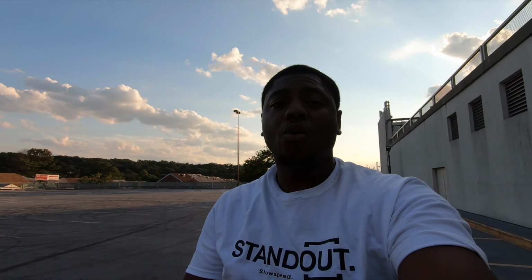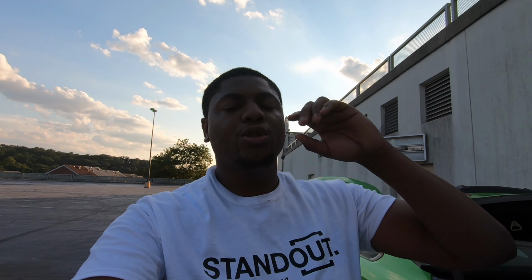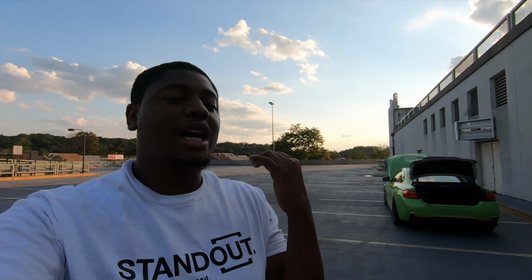Now don't quote me, but I think the kit comes with a CM3, a CM5, and a CM7 size nozzle. I know that it comes with 3, and I use the one in between. I'll put down below the nozzle sizes that correlate to the horsepower ratings you guys plan on running in your car. Like I said, I chose the middle one. I think it was like 500 to 650 wheel horsepower. They recommended you use that.